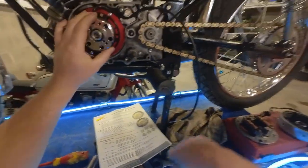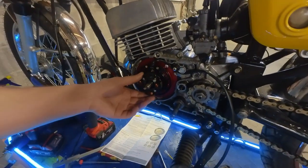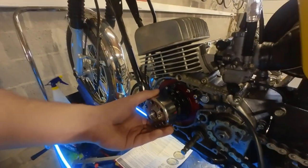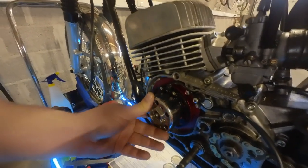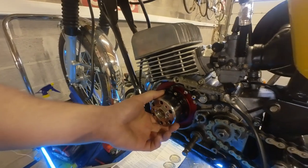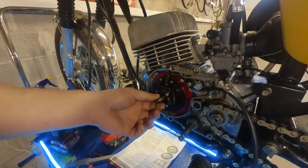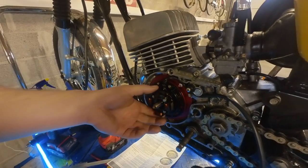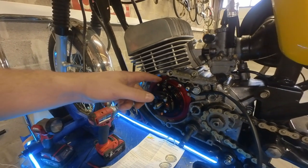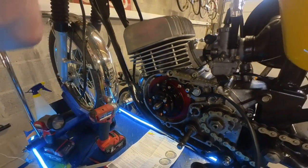You can feel it - that's two millimeters before top dead center. Now as per instructions, we have this mark on the rotor and we have two marks on the stator. We have to line these up at two millimeters before top dead center where the engine is right now and line up these marks like so. Now we have to tighten this nut. When we try to fit the rotor and tighten the nut, it just clamps onto the stator and the whole engine is stuck. I'm not sure why. I can't imagine the RD-50M or the DTs have a longer crankshaft, but I have a slight feeling that maybe this base plate - the red one - is sticking the stator out too far.